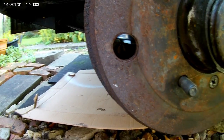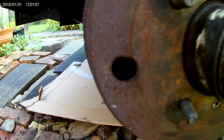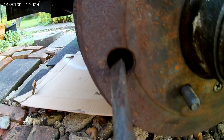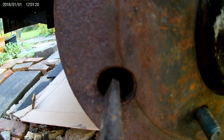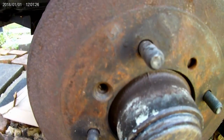We need to do the other side as well. There are two cylinders, two adjusters, so that's the other adjuster. Get in there, tap that good and tight, and then let it back one click. That should be slightly dragging, but not binding.